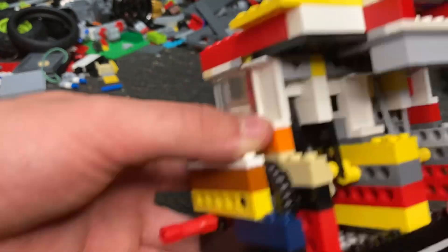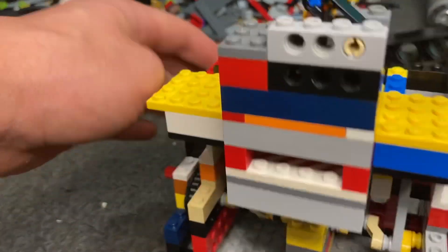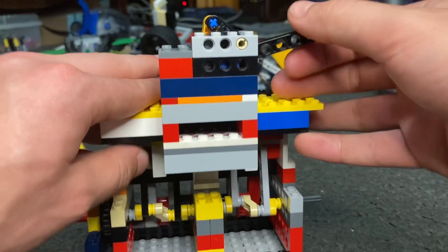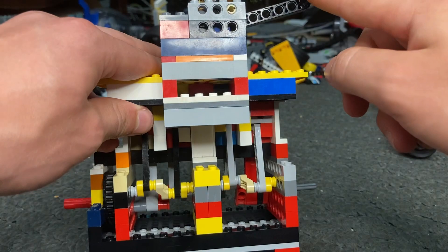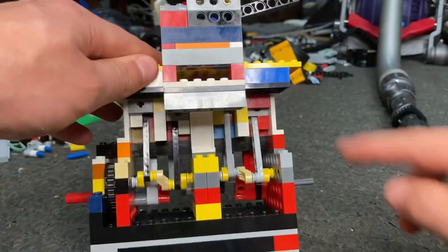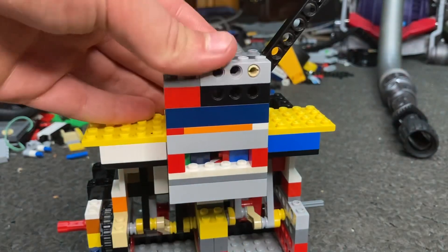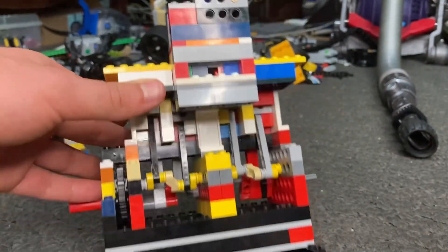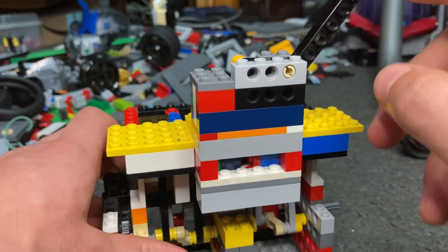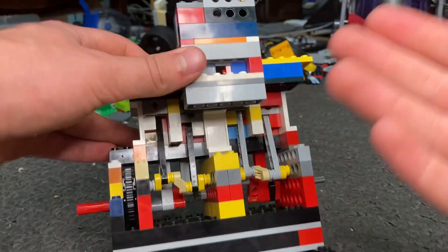As you may be able to see in there, it's actually driven by a chain. It also uses a slide throttle — you pull in the throttle lever here, it opens up this part inside here, and controls the amount of airflow that gets into the engine. I really like these slide throttles; I think they're very effective and useful, and they do their job exceptionally well — better than the butterfly throttle valves that open like this instead of upwards and downwards. I definitely recommend using a slide throttle from now on in your engines; I've seen an increase in performance because there's less leakage.